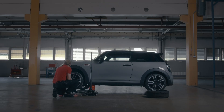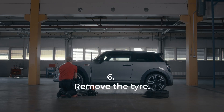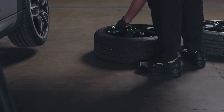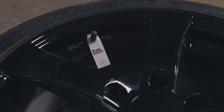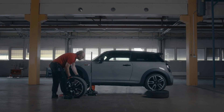Remove the wheel nuts. Take care of the nuts so that the threads do not get dirty — clean them. Remove the tyre. Mark the position of the tyre: left front, right front, and so on. This is good to do if you need to rotate the tyres the next time you put them back on. Brush the hub free from rust and dirt.